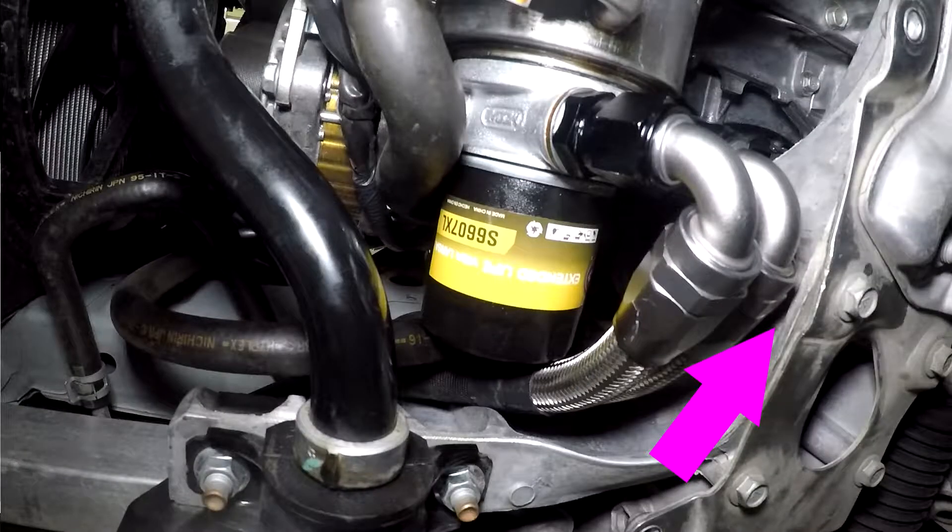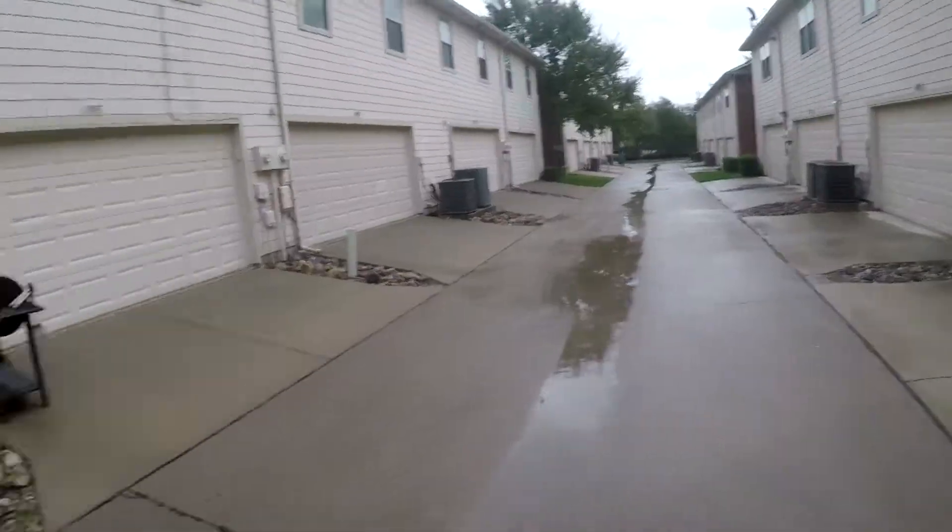What's going on guys — it's day two of this install. Last night I ended up having to stop filming because I was running out of battery on both cameras, and I was up until about one in the morning getting everything put together. I managed to get the oil cooler lines on and the sandwich plate is on the car, and the car was filled up with oil. But a thought kept me awake — I had left the oil cooler lines a bit too close to the cross member. When you're revving the engine the oil cooler line is going to move and if it bangs against the cross member it could damage the lines. So this morning I'm going to undo everything, re-drain the oil, and space it so there's enough room between the lines and the cross member.